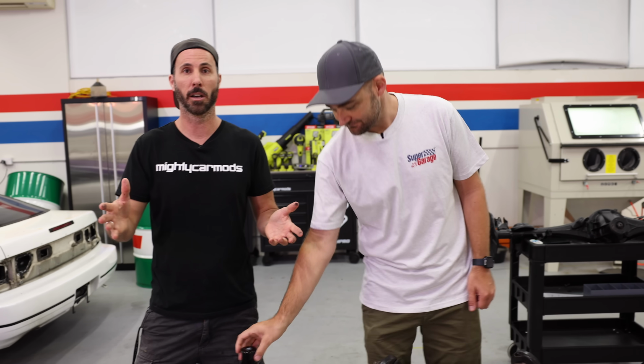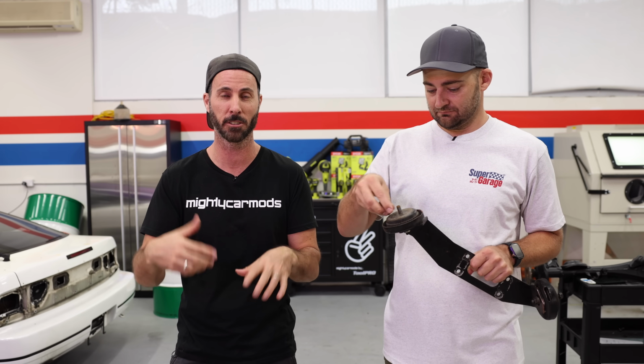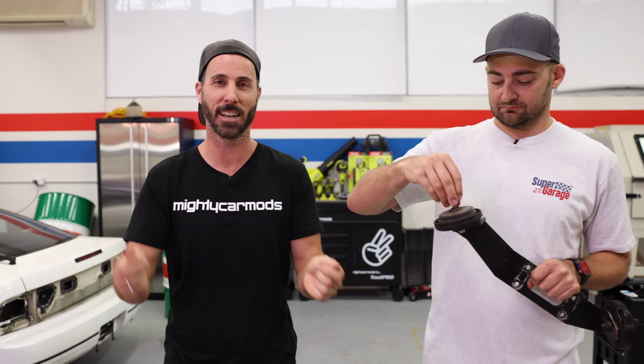The same kind of thing applies, of course, to engine mounts as well. So there is some performance gain. It is actually a thing that people do, because there's all sorts of side-by-side comparisons of what factory engine mounts look like when you boot it, and your engine's kind of making some movement before that power is transferring down. So some people can replace those. It can lead to an increase in harshness and vibration, so you've got to weigh up whether it's worth it.